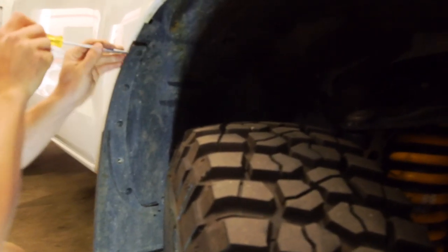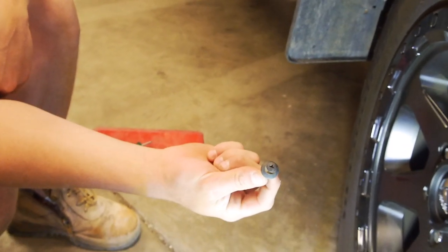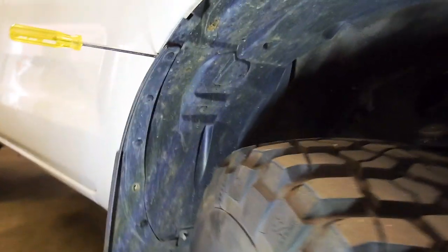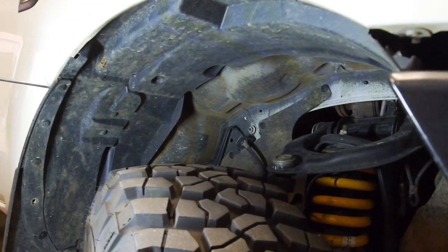All right, so back over to the inner guard here. If you've worked on cars before, you know how annoying these stupid trim clips are. Essentially it's a little plastic Phillips head that's easy to strip. You're meant to back it out, show us this one down here, Ollie. She's gone. That's essentially how it's meant to work, but 50% of the time it doesn't, so be prepared that you may have to just wrench them out. You can buy replacements, but we'll see how we go. You've got to take your mud guard off, which sandwiches the inner guard, and then there's just a few. Yeah, and down the bottom, and some down here, so that's pretty easy stuff. If you've got a lift like Ollie does, you won't even have to take the wheel off, hopefully. Get these off and see what we're dealing with.